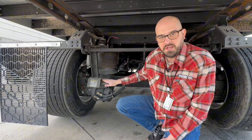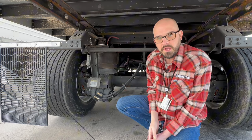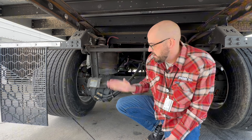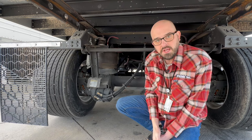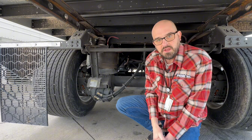You don't want to have this sitting on this plate when you're driving down the road, because then you won't have any suspension — it'll be sitting on the plate instead of riding on the airbags. But other than that, you shouldn't see any problems here. If you do, get a hold of Road Assist and we'll help you figure it out. Beyond that, thank you all. Stay safe out there.